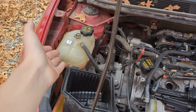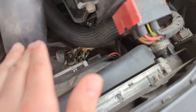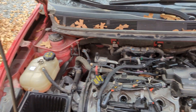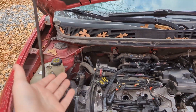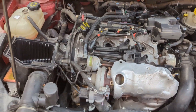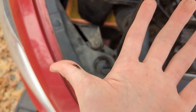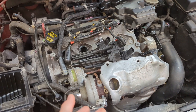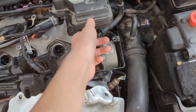If the oil didn't get into the cylinders, it dripped down the side of the engine head into the intake. You can see the oil — I've wiped off most of it, but I tipped it upside down to drain the excess. This PCV line goes straight to the turbo, which is not good — turbos need oil but not oil going right through the air inlet; there's not supposed to be any oil there. Another issue is the radiator: that little black hose down there connects to a cracked radiator, which caused coolant to leak and forced my dad to refill it every few hundred to a thousand miles.